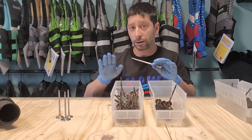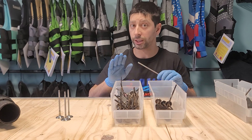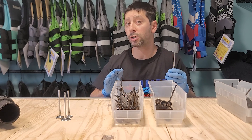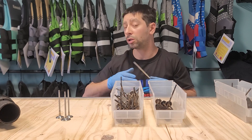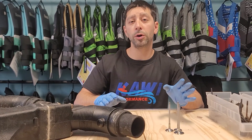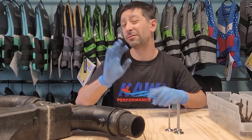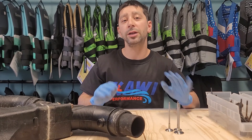Without the exhaust filter, these valves are really, really high quality, so there's really no reason — unless you're submerging your engine — that you need the exhaust filter, as long as you blow out the moisture after every ride. That just means firing it up and shutting it off five or six times after you're done flushing, and you will never ever have an issue with moisture going up into the motor.